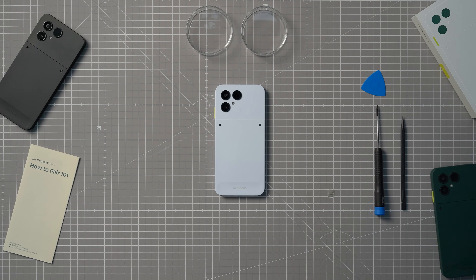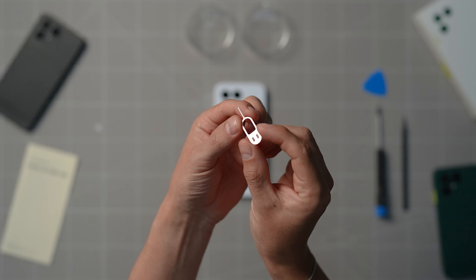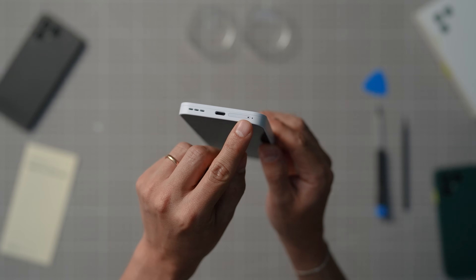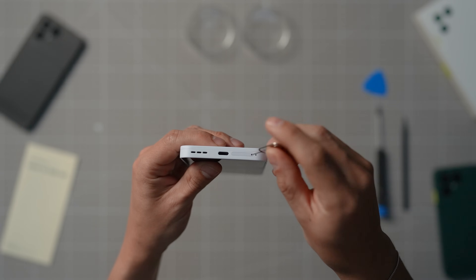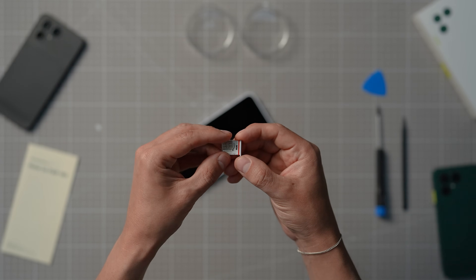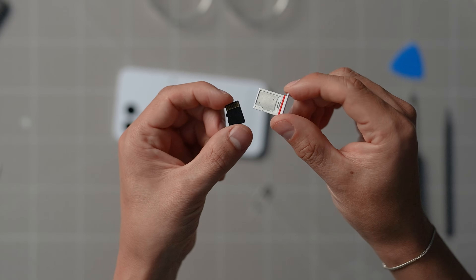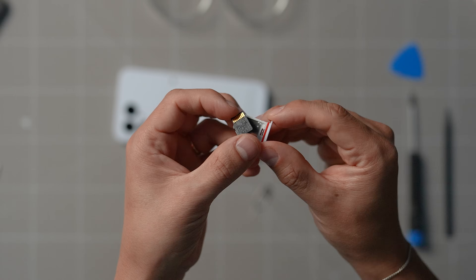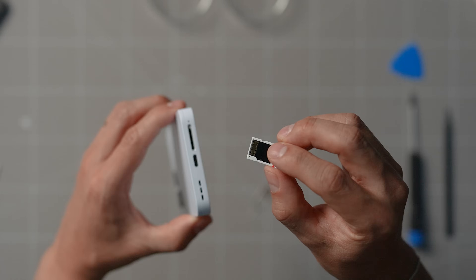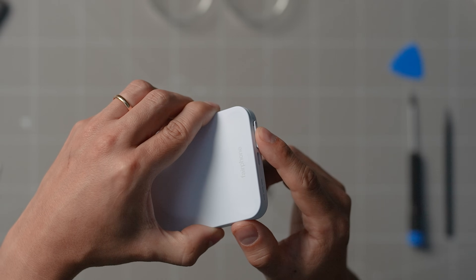If you are using a physical SIM card, we recommend popping your SIM card in before switching on your Fairphone for the first time. You can use the handy SIM card removal tool for this. See this tiny hole on the bottom left of your device? That's where you'll need to push the tool in. You should hear a tiny click and the SIM tray should pop right out. The SIM tray can also house an external SD card, helping you expand your onboard storage up to two terabytes. The SD card goes on the back of the SIM tray, so make sure to hold both the SIM card and the SD card in place when sliding it back in. Take special care not to scratch the cards and make sure not to force it in — it should go in easily.